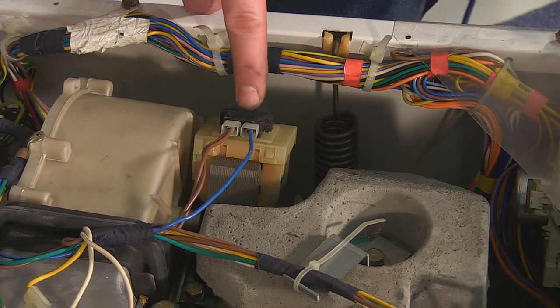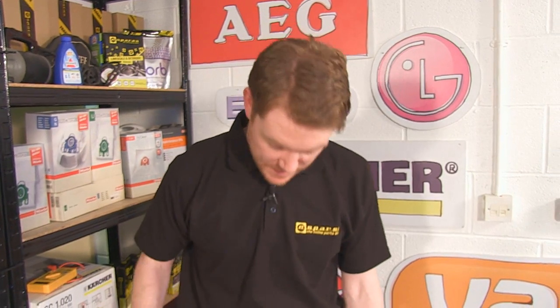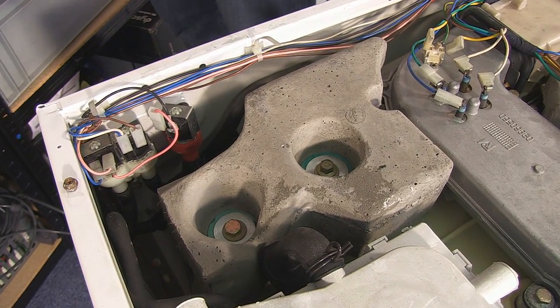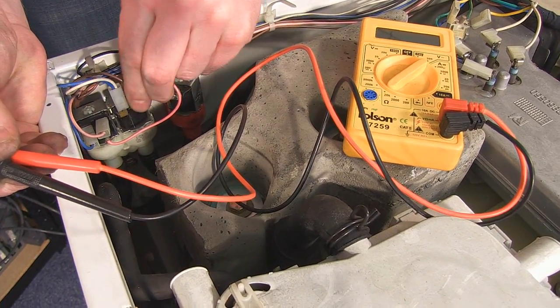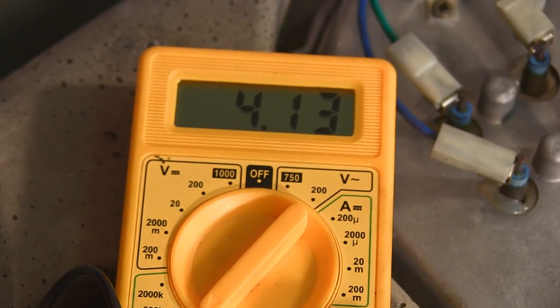You can also check your motor using your multimeter — a reading of below 500 ohms means the motor is fine. If your washing is taking a long time to dry but is coming out very hot, it could be that water is not being fed into the condenser. Simply follow the hose from the condenser to the relevant valve and then you can check this with your multimeter. A reading of around 4000 ohms means the valve is fine.